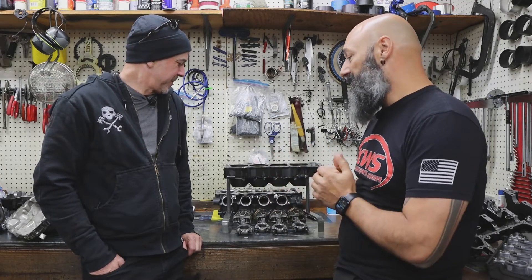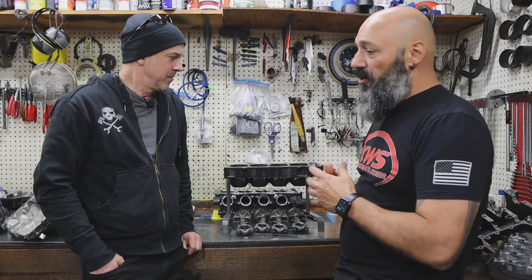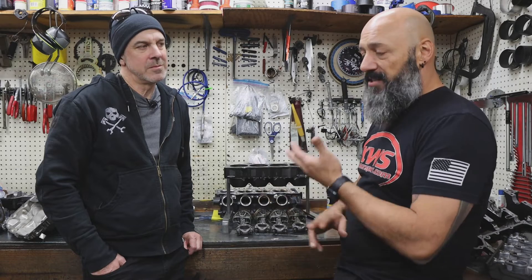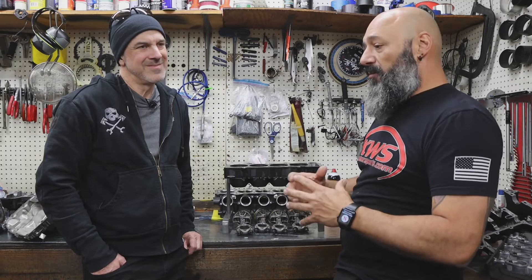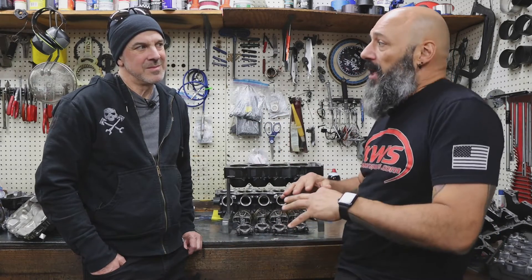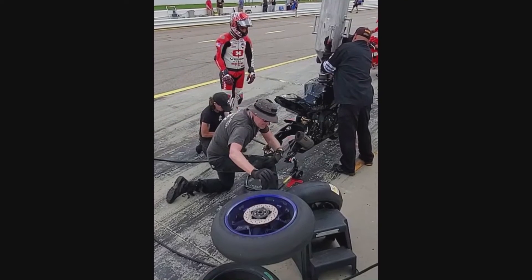The key to this motor is life — we want as much life at the level that it's ridden at. If this was a sprint motor where you really care about peak horsepower, we could start doing all kinds of things: raise compression, change cam timing — that would be like a normal supersport, super stock build. We could start really trying to get power — put a bigger piston in, bigger cam, porting the head. Not only does it really increase the cost, but it does bring the reliability of the motor down. The more you do to the motor, the faster and stronger it is, but the less time it's going to last.